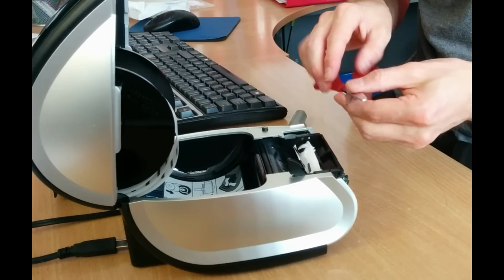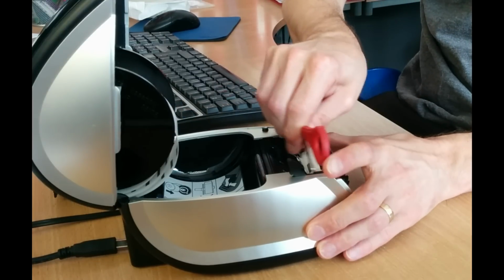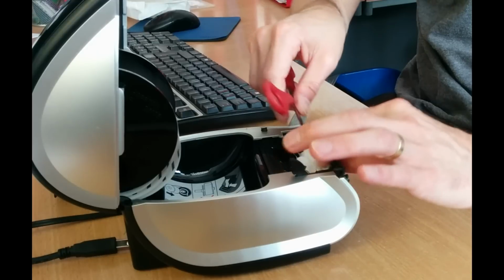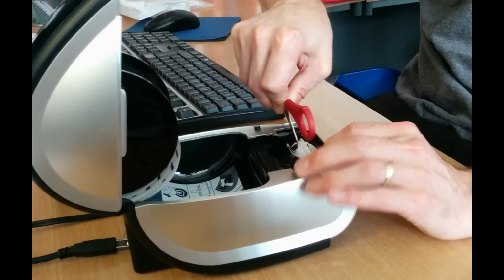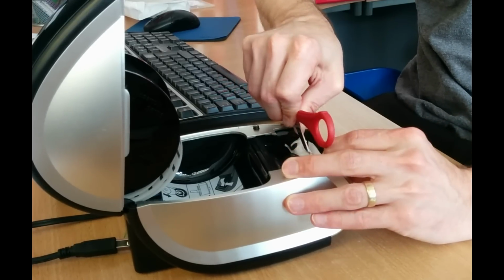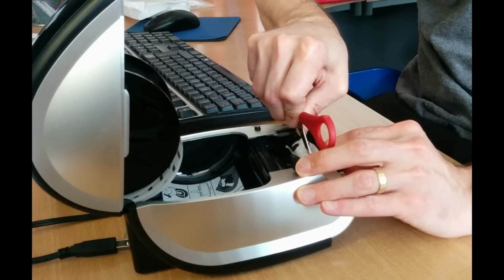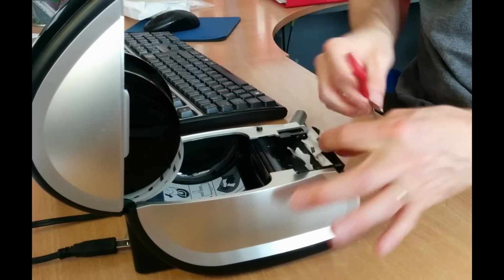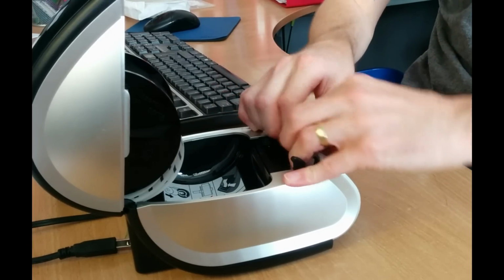And I've found after unjamming these many times, the easiest thing is just to score along the top, but while not pressing so hard that you might cut the spongy thing underneath. So basically run a fairly dull scissors along the paper multiple times just to cut through the paper and leave you with being able to peel it away and seeing the roller underneath, and then you should again with brute force be able to pull those labels out.